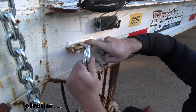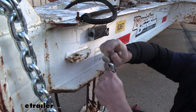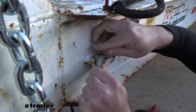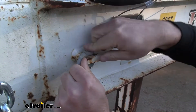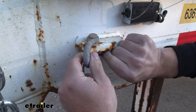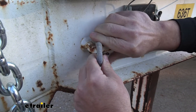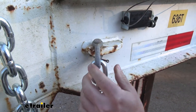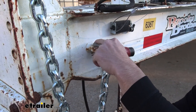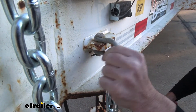It's really easy to get this installed. We went ahead and removed our old one that we're going to replace from the side of our trailer. I'm going to just take the shackle, add the chain to it, line up those holes here on the side, drop our clevis pin through there at the bottom, line that up, and then put our pin back in here at the bottom. Ours is a little rusty, but I can push it in a little bit by thumb and then I'll get the hammer just to make sure it goes all the way through. You don't have to hit it hard, just a couple of taps to see more of the pin on the other side. Then you can bend those tabs out and it's good.